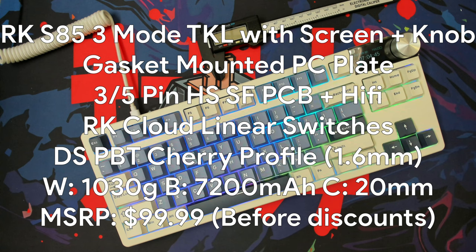The chin of this keyboard sits at 20 millimeters above the typing surface, while the back sits at 33 millimeters, providing for a default typing angle of 7 degrees. Flipping out the bottom set of feet will take the back height to 37 millimeters and provide for a typing angle of 9 degrees. Flipping down the final set of fold-in feet will take the back height to 43 millimeters and change the typing angle to 12 degrees.